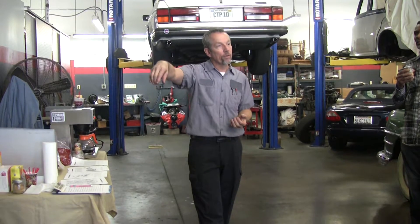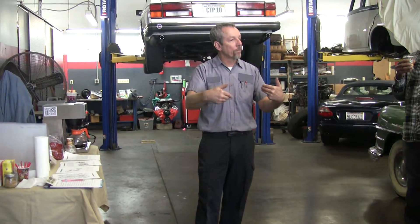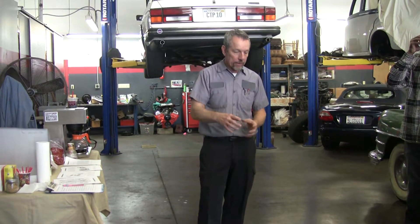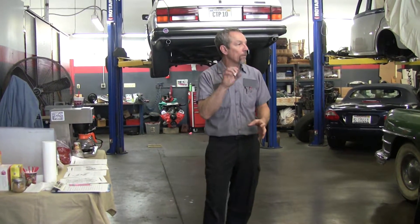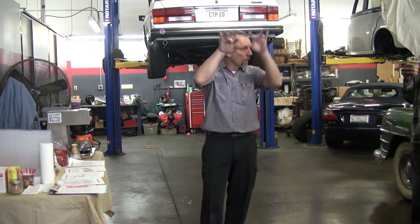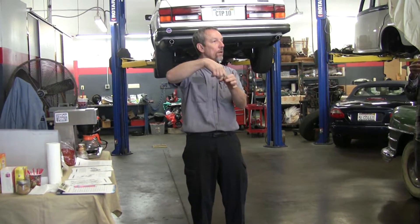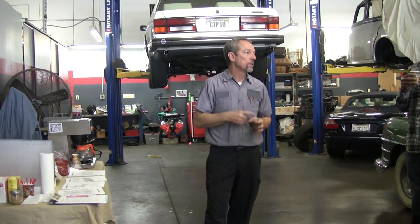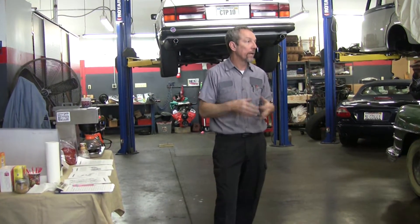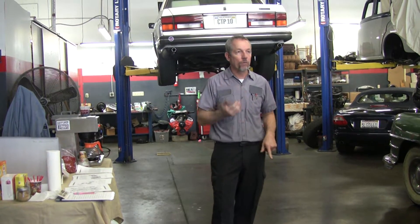In the floorboard, underneath the driver, on the left side no matter what - you pull up the carpet. The filler is on the right side of the hump where you add and check transmission fluid. On the left side there's a little access plate about this big with six screws. You can take that off and get to the band adjustments. I do them from underneath - it's a little harder, but I can do it by feel. Off to the left of that there's a little rubber plug; you lift it up and there's a set screw adjustment on a lever where you can adjust your TV shift. That's presupposing everything else is in proper order up the line. Every time you service it is when you want to adjust that.